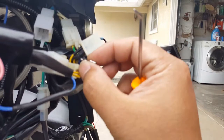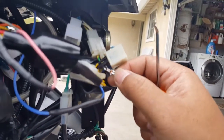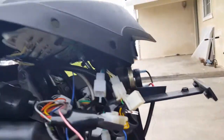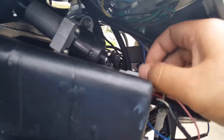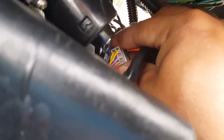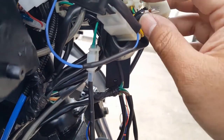This is originally from the scooter. Why would they have this? Did we do something to it maybe earlier? We poke a probe to it? But I don't think the probe would do that much damage. Because if that was the case, we could check our pink wire here and our gray wire, because we did the same thing to those. Let's see if they actually strip apart. See, those guys still stayed intact. They didn't have any problem. So, why is our black wire here having this problem?